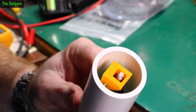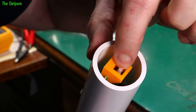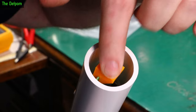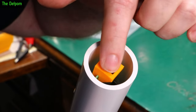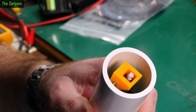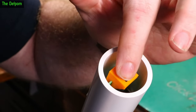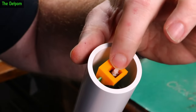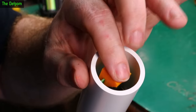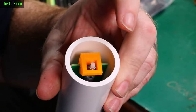That helps to protect the switch. Because these switches are really hard to feel through the rubber cap, people will push them too hard — pushing and pushing really hard trying to see what's going on. Sometimes they push them too hard and break the switches. With this cap, when someone pushes the rubber cap all the way down, the switch goes below the surface and they're pushing on the surround instead — the orange piece — which pushes directly on the circuit board. So it's much safer and much harder to damage the switch. It also means when you're pushing on the top cap you feel the big platform, which makes it much more obvious when the switch has bottomed out — you feel it stop and know that's the bottom of the switch. I've actually forwarded this design onto PharmaTech for them to replicate it.